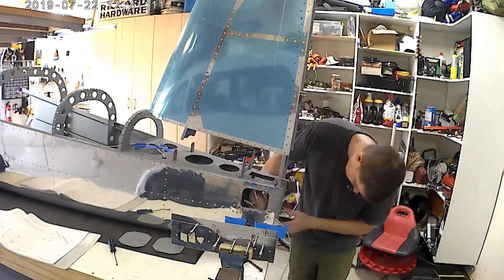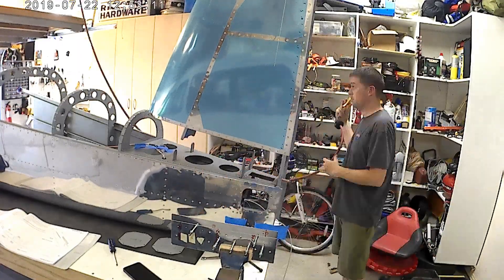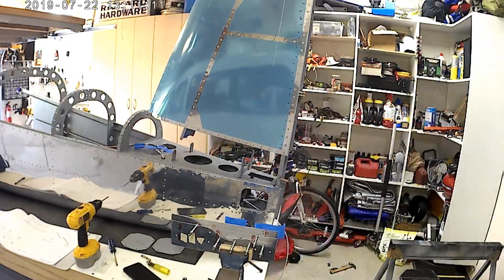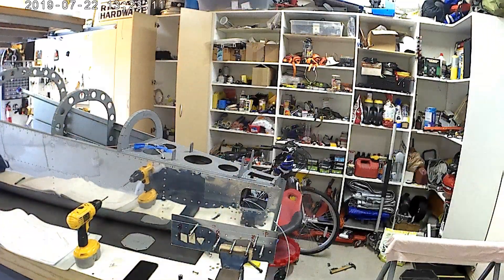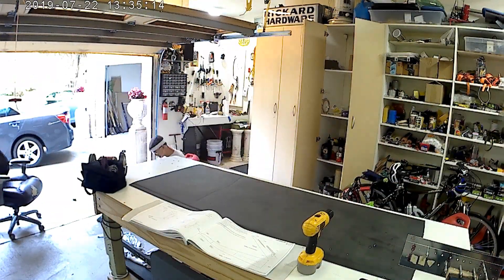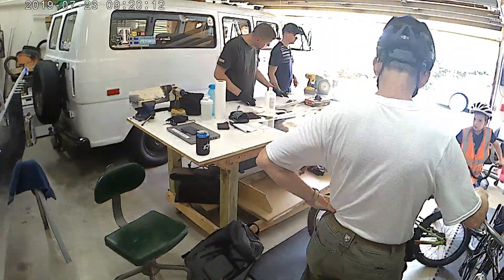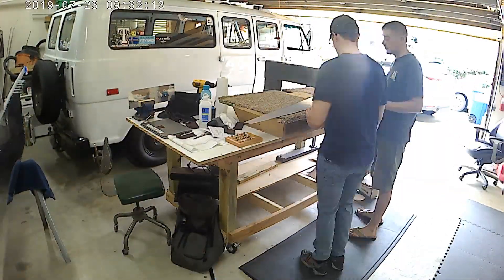Here I'm taping the ELT wire. This is the point where you put the rudder on, drill a couple of holes, and then take it right back off. My father-in-law held up a 90-degree angle so that we drilled the holes absolutely perpendicular to the web in the aft rib. Somebody on Facebook had been slightly misaligned, drilled an unintended hole, and while it's not completely destroyed, it's quite a lengthy repair.